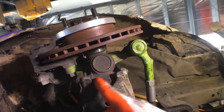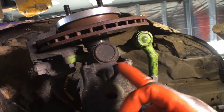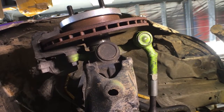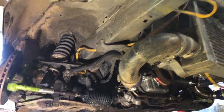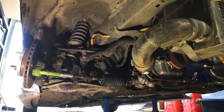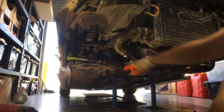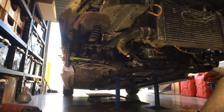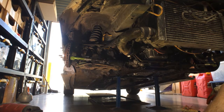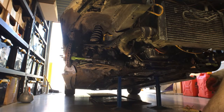At the bottom there's a ball joint — you can see I've got a spacer on this side. I actually cut that section of the ball joint off and spaced the whole ball joint forwards to give me more caster, which worked really well. I've got 10 degrees of camber by extending the lower control arm, and I think it's got seven degrees of caster. With all that camber and caster, the steering gets quite heavy — that's why the non-power rack was not working. If you're just drifting an MX5 with maybe some rack spacers, a depowered rack probably works sweet, but with this aggressive setup it starts to feel pretty heavy. I just didn't want that rare chance where the extra load would catch me out in a tricky situation.